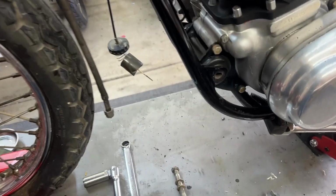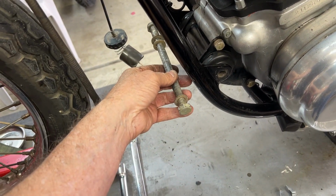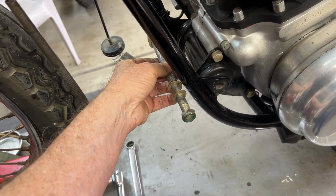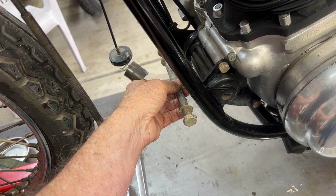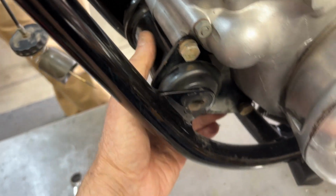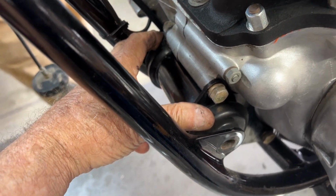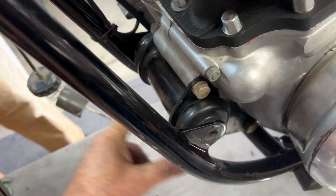All right, interestingly, I just pulled the front bolt out of the center of the front ISO, and it came out this way, head first, this side. Normally, the head's on the right side, and the nut's on this side. But it was in facing this way, which actually works just fine, thank you. But it is surprising, so it made us take a look at this front unit, and it is very nicely painted. The rubbers are really good condition, and I have the funniest feeling that this ISO has been taken out at some time recently, maybe, and we're going to find out if it's an adjustable or if it's the old-fashioned shimmed one as soon as we take this unit off.